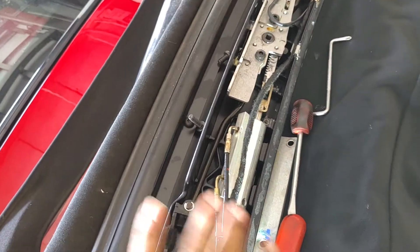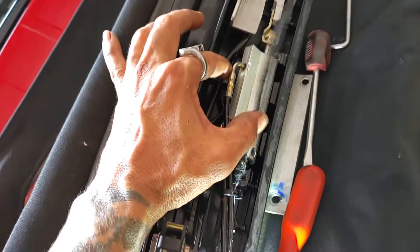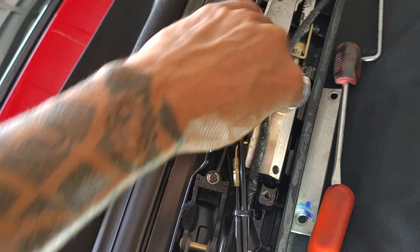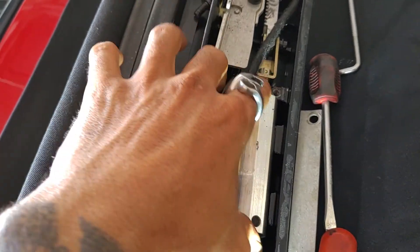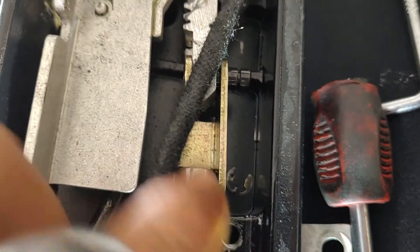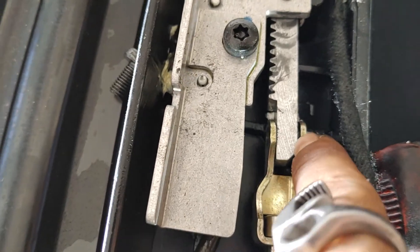Once you open it, this is the cylinder that controls the locks — it's leaking. Two bolts, T30s, go in here sideways, and then there's a little shim you don't want to lose, it just shims in there. Remove the two bolts and then there's a little pin I just took out from here.